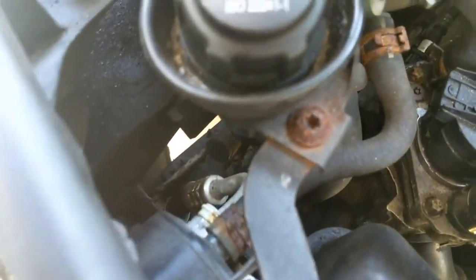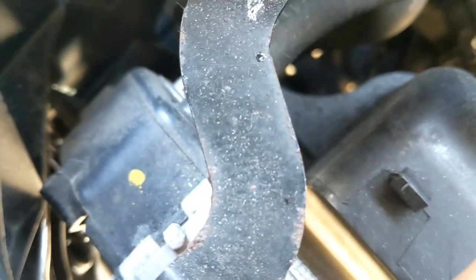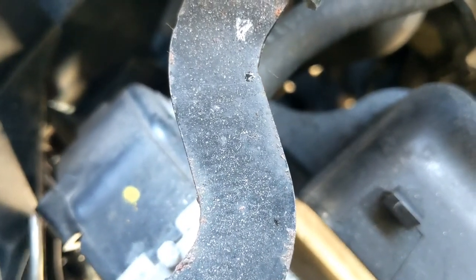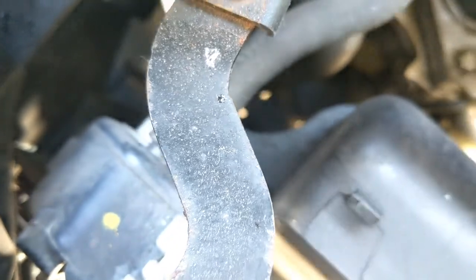All right, so now pushing the radiator in with one hand, and then you're gonna come with this hook right here. You're gonna press that in order to slide the condenser up. If you don't push that in, it will not slide up.